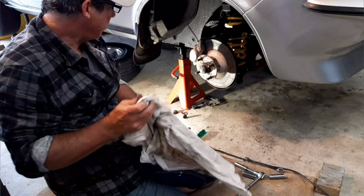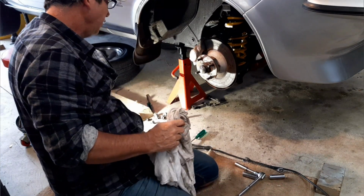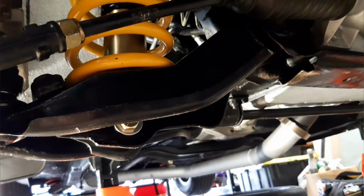And I'll get you down here for a looky-loo. So here we go, here's the spring in place and the shock. Bolted through the bottom, new ball joint there, and that's all good to go. I've just got to tie in the sway bar now to that lower arm,